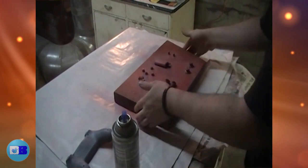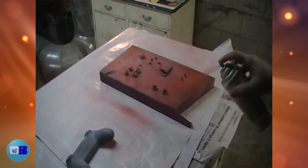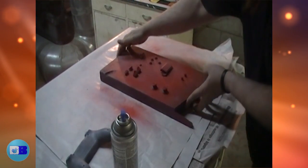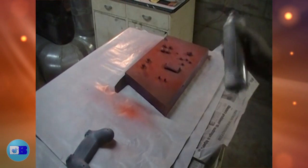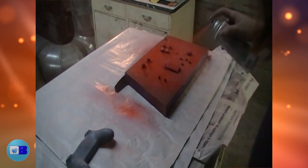You can see that while I'm spraying the paint, I'm sweeping left to right, and once I've come to a full left swing, I let go of the nozzle, and then as I'm pulling right within that sweep, I am also hitting the nozzle. So it's only applying while I'm in motion. You understand? Very, very easy technique. Eventually it becomes muscle memory.